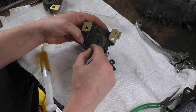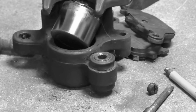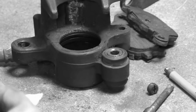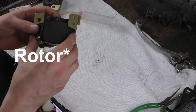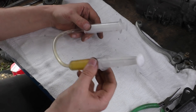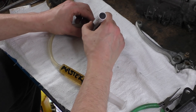As we saw with the SV, if you push fluid into here the piston pops out — there's a really small passage around the back. Get yourself one of these guns with a straw on it and you can pop out your piston — no need for compressors. That basically pushes the piston out, which pushes the pad outwards against the rotor. So this is your master cylinder and this is what we call our slave cylinder — your slave cylinder does what it's told when the master cylinder does its thing.